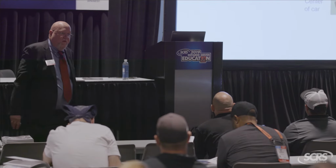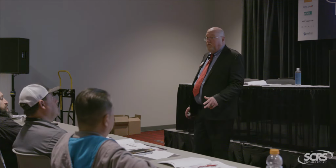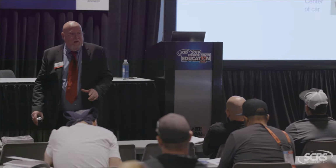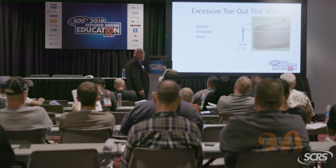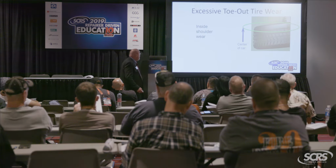So here's what I typically see with a car that was involved in a collision where the alignment got completely overlooked. Somebody will say, well, go on ahead, get an alignment, and then your tire won't wear anymore. In fact, it might straighten up. No, once that wear pattern's there, guys, it's there. And toe is very choppy and aggressive and abrasive, and that chopping pattern that's developed in that tire is going to cause all kinds of nibbles at the steering wheel, vibration forces, and lots of noise, okay? And there's nothing you can do to make that go away. Turning the tires around won't make it go away. Putting the front tires on the rear sometimes makes the vibration and noise even worse, okay?